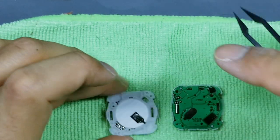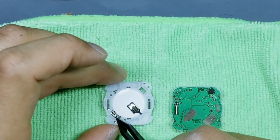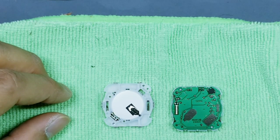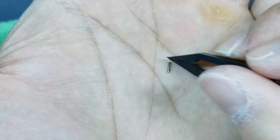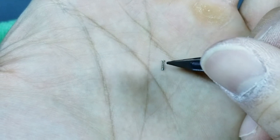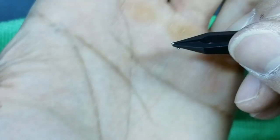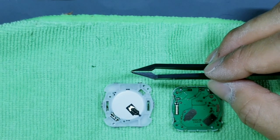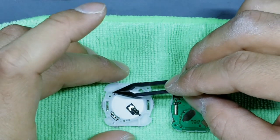And you're going to go ahead and grab this portion of the watch module. Put these two tabs at the 6 o'clock position as well. Grab your spring. Now with the spring, take note of the way it's shaped. You'll notice that it's wider at the top and skinnier at the bottom. I'm gonna grab from the wider end like this, turn it like this, and insert the skinny portion into the hole that we marked with Sharpie from before.